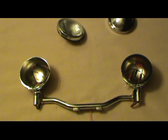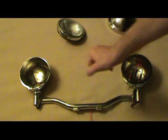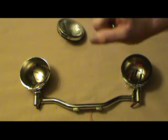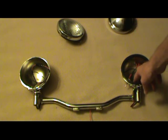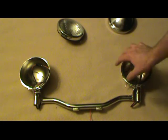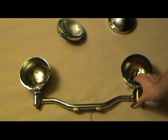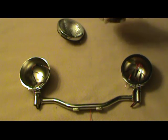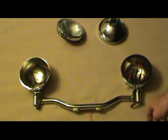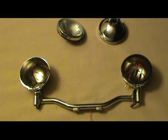At this point I'm going to deviate from the instructions. Instead of centering the lights and tightening them now, I'm going to mount the assembly on the bike and center them while they're on the bike — before putting the passing lights in, because once you put the passing lights in you can't move them without taking them back out. So I'll mount it on the bike, tighten the bolt and nut down, then put the passing lamp back in. At that point, we'll also take the turn signals off, which will be mounted facing down.